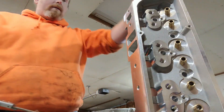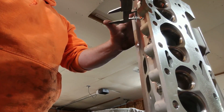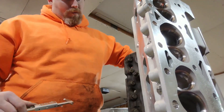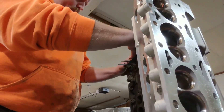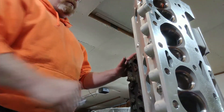What about the exhaust? The exhaust is about 1.40 on the new one, and on the old one — if I can get it turned around without knocking everything over — it's pretty similar, about 1.37 or 1.34. So the point is: we're flowing more volume with higher compression in the new aluminum heads.